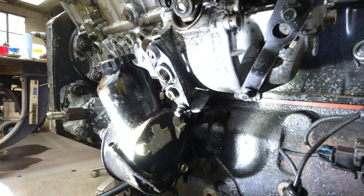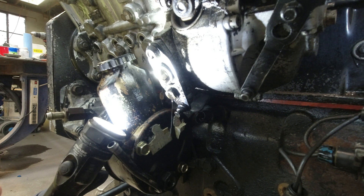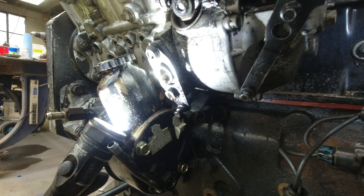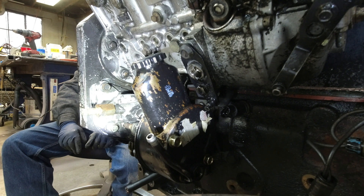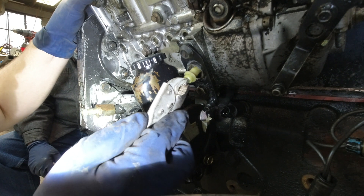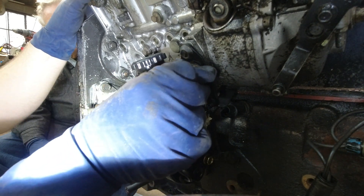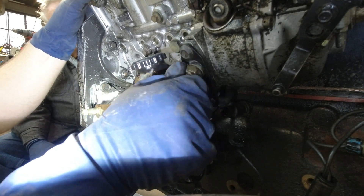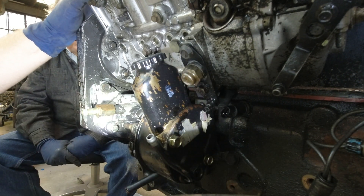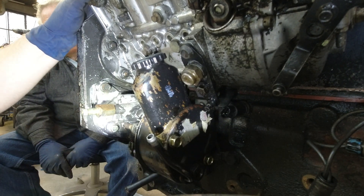The degree wheel is at about 10 degrees. It's starting to come — a little bit at a time. I got the flag now. You can see it — we've clearly rotated the motor and that's in. Right there — that's got our pump. That side of our pump is right at the cam pin, at the top of the stroke for number one cylinder. You can tell it's in. See, I just put this in there — it goes all the way back flush, which means it's all the way in. I put the cap on just to confirm it was all the way in.